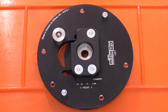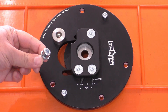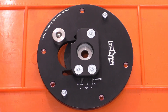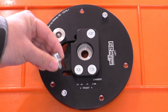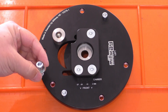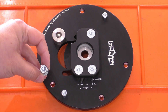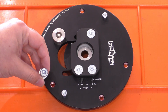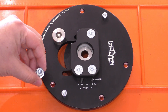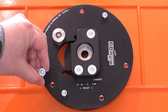Also included with these camber plates are a bunch of grade 8.8 M8 hex head screws to secure the camber plate to the shock tower, and there's a little washer that goes on each of those as well. I don't particularly like hex head screws for things that get torqued down very high, but these are only about 30 Newton meters, so it's not a huge amount of torque — this is probably okay.